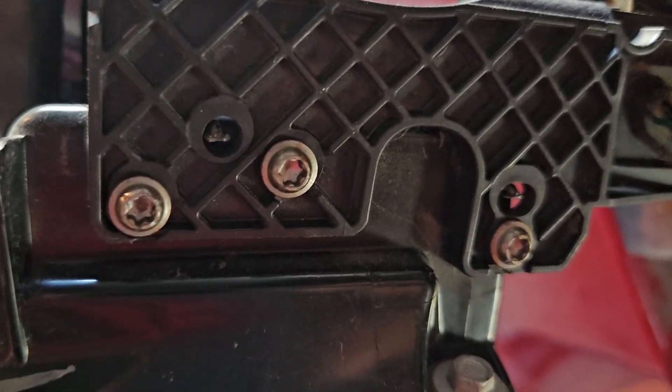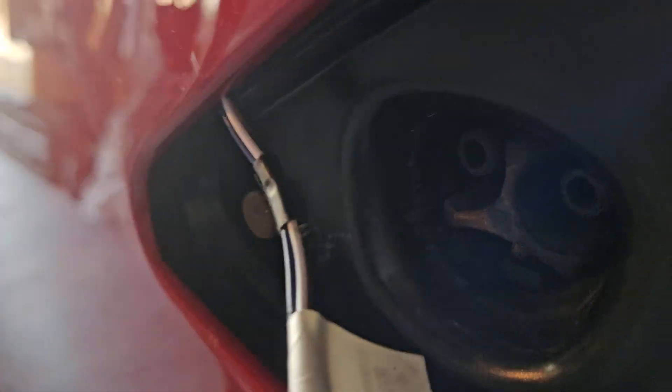Then wiggle the light out — it will have parts attached to it. There are three T15 Torx screws. The plug will be loose; unclip it using a screwdriver or a hook. When you push it you'll have about an inch to an inch and a half of room. You're going to need time because Teslas are over-engineered, everything is tight and very well made. Unless you want to fully disassemble it, this is at least an hour job if you have the tools.